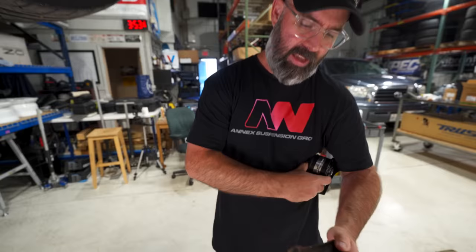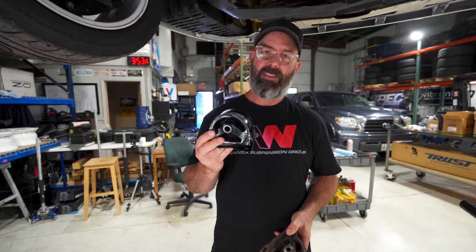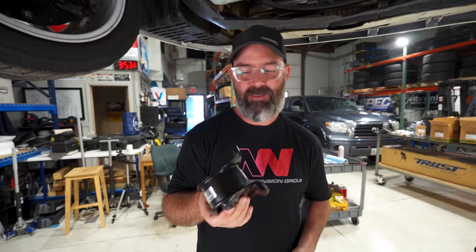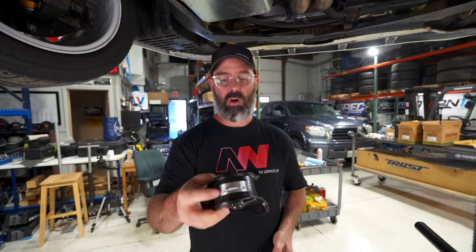Just so happens I have these Hard Race mounts. Do you remember these mounts — wait, I thought you sold them? Well, I took them out of my budget because I didn't install them, but I didn't actually sell them. I put them into the hoard. Since they didn't go on the car you would have technically been over budget — well, these were only about 40 or 50 dollars. In any case, I forward-planned and held on to these mounts. This is a hardened rubber mount, so not only is it not ripped, it'll also have less play than the factory mount — double win. And nothing coming out of my budget this time because I've got no budget.